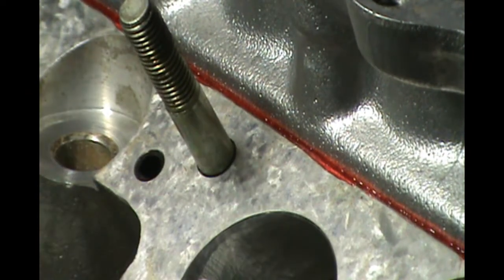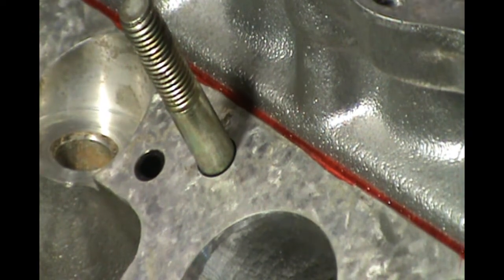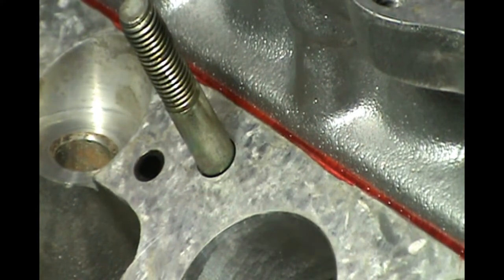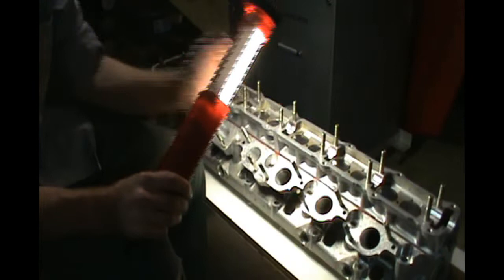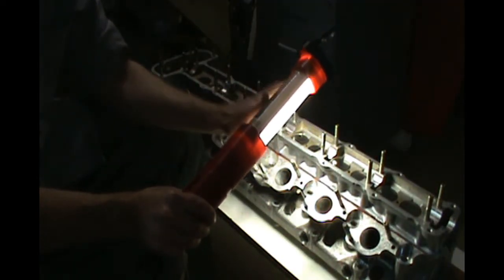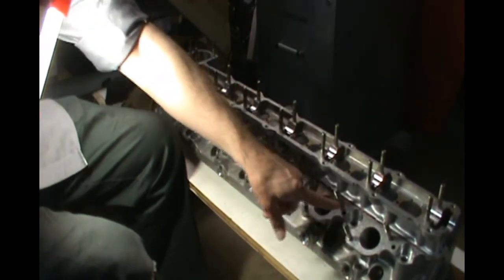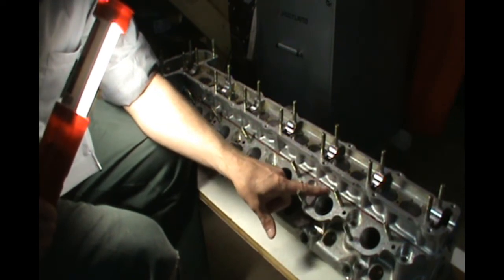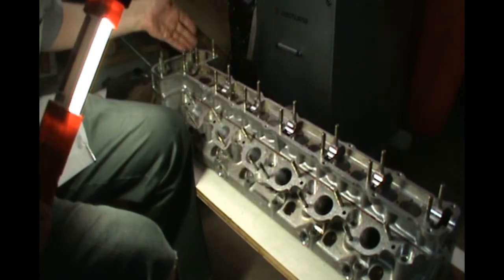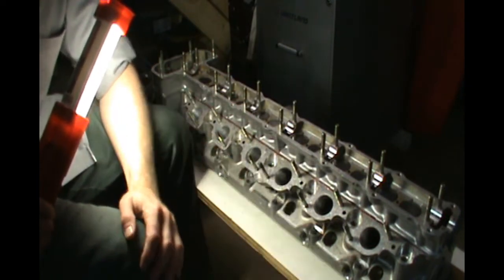Now, when you're doing this, you don't want to use something like the typical RTV, and that's because the inner section of this tappet block is directly associated to the oil channels, and an RTV kind of gasket over time will degrade, and small beads of RTV rubber plugs basically will fall off into the oil chambers and clog oil passages, and you could possibly ruin your engine. So you want to steer clear of using an RTV type sealant here. I'm not saying you can't, I'm sure some people have very successfully, but the anaerobic style gasket maker doesn't harden when it's exposed. So if any comes off on the inside of the engine, it will remain as a liquid-ish state and get flushed out with any oil changes.